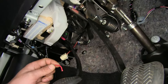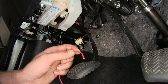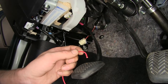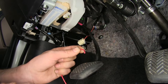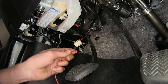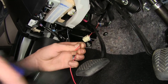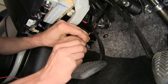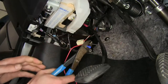Okay, if you're installing a towed vehicle braking system or a supplemental braking system in your car as well, and it has an indicator light, you'll need to install an additional wire that's not included with the kit but comes with your vehicle's braking system. We're gonna tie that in with the blue wire closest to our connector. So we'll strip off some insulation from it and we'll twist these two wires together. We'll take our blue butt connector, which comes with our relay, and we'll crimp it on.